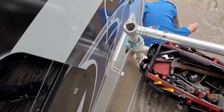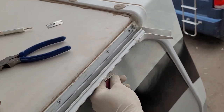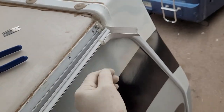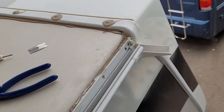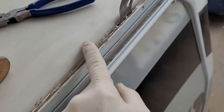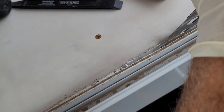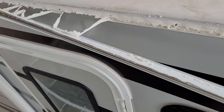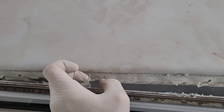I dropped a screw on the ground — yeah, I'll forget it and then the trailer will run over the tire. So I'm going to go ahead and get underneath it right there and start prying up on it. Should just be some butyl putty holding it up. Looks like that's going to come free pretty easily — relatively easily. I just don't want to pry against the rubber right there because I don't want to rip it. You can see the butyl putty — this is actually high-quality butyl putty. I'm just going to carefully pry this back.